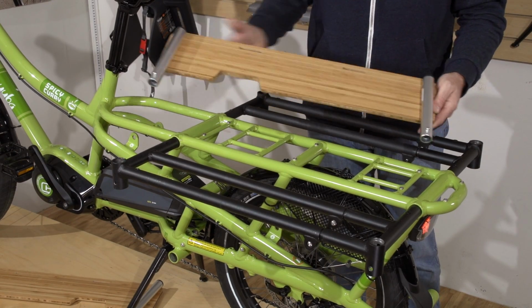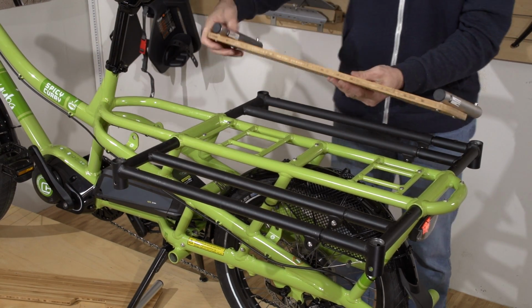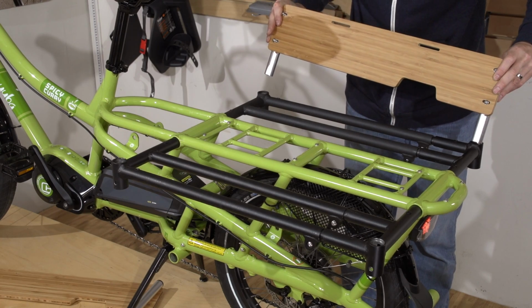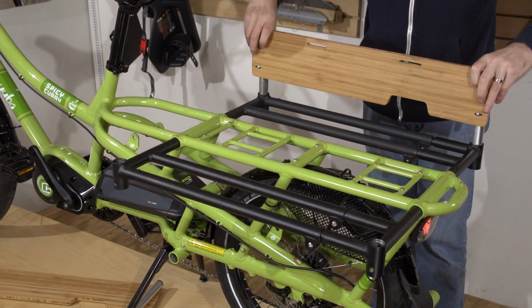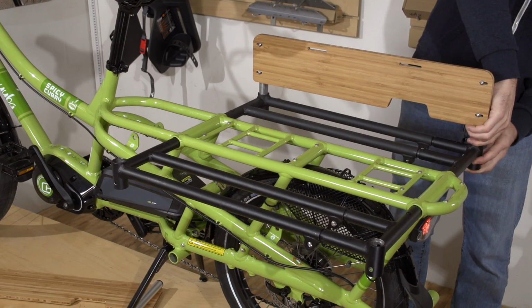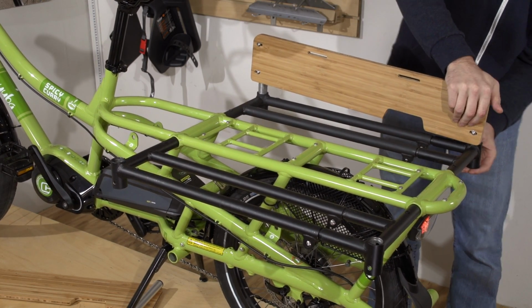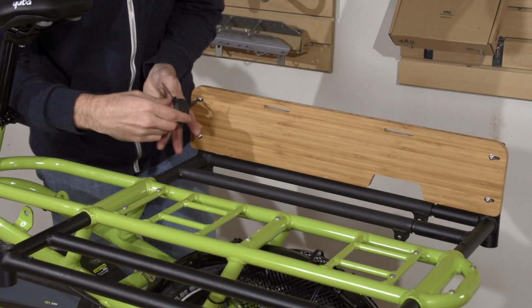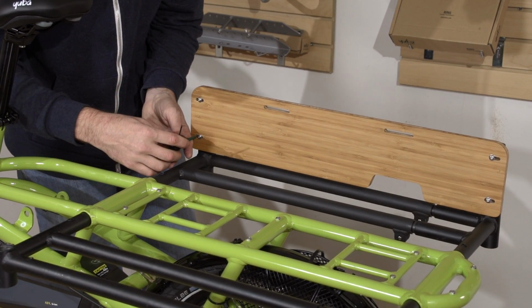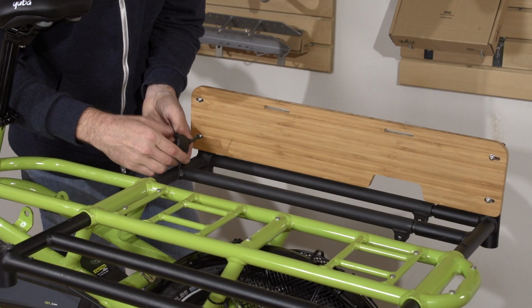The carry-ons can also accommodate a set of side boards. The side boards can slip into place here to form a truck bed. Press down and make sure the spring clips click into place. Using a 3mm Allen key, tighten the bolts to secure everything.